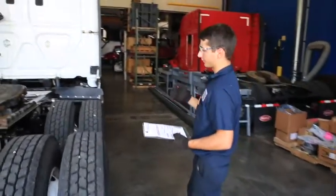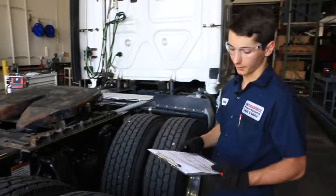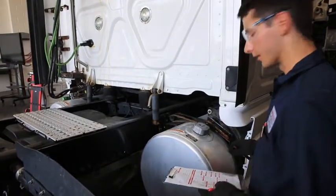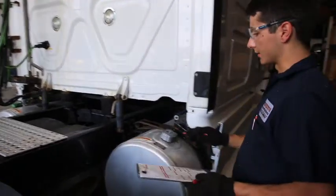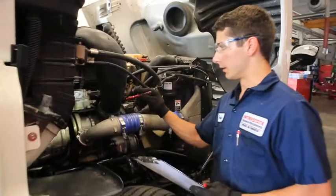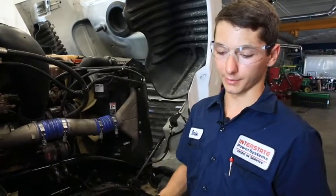Coming to the back, while walking around the truck, inspect the frame rails — make sure all the hardware is tight and present, with no illegal welds or cuts on the frame and no shiny threads or rust trails indicating looseness. After that, check the second fuel tank as well, making sure the fuel tank straps are fully secured and there are no visible fuel leaks. Then check the exhaust system — start from the exhaust manifold and work your way back underneath the truck — looking for loose hardware indicated by shiny threads, as well as any black soot trails between mating surfaces indicating a loose or leaking gasket, checking all the clamps down to the tailpipe.